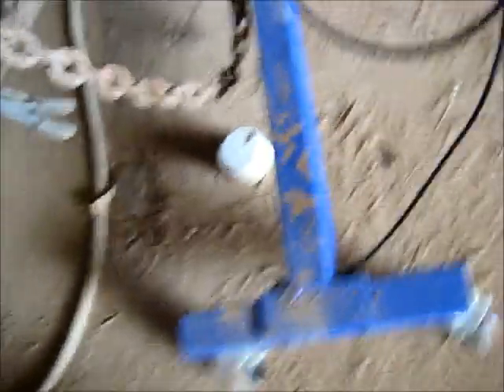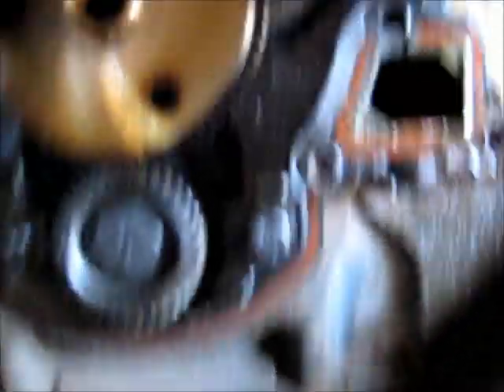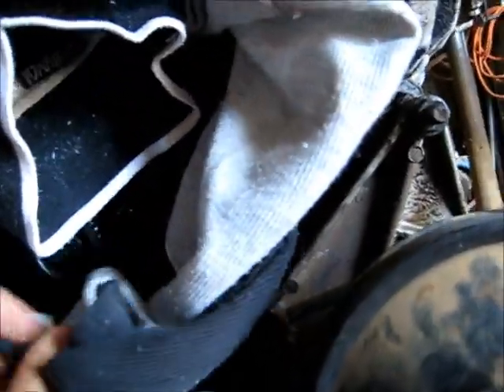You can see the rings there - they look pretty damn good. That bore looks pretty good. That's the oil pickup - oil goes up there. There's a camshaft and roller lifters there. There's a timing gear that goes in there. You'll see it back together carefully. Cover it up - don't want to get any dust in this. There's the front half, there's the camshaft, that's the balancer shaft. Underneath - if you take this inlet manifold off you can see the balancer shaft underneath. The timing chain goes on the crank, and there's a little thing on the camshaft that times it. There's little timing marks there, but that's all going to be done apparently - the timing chain and tensioner are getting replaced. It's got a slight amount of wear but if you want to get the bottom end fixed you might as well replace it. There's the iridium spark plugs with a good small point tip on them.